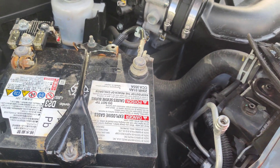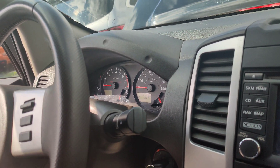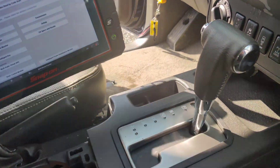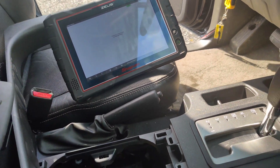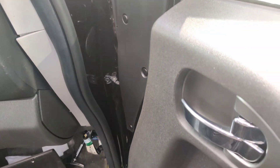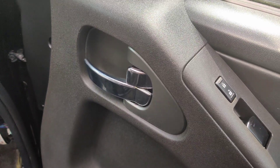I'm going to connect this back up and we're going to see if we have our airbag codes. We still have the same code on the dash where it keeps flashing the 7. I'm going to scan it again. I'm going to take the door panel off - I want to make sure the sensor is actually plugged in. Maybe we'll scope the signal, see if they forgot to plug it in or something.